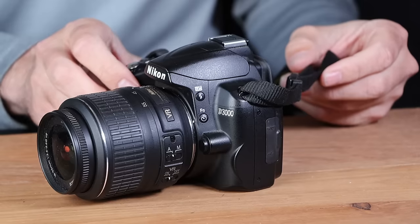The shutter count of this camera is 5,391, which sounds like a lot, but the average D3000 I sell is in the 20,000 to 30,000 range. I believe it's rated around 75,000 to 100,000 shutter actuations, so there should be quite a bit of life left. The value for this with the LCD scratch is going to be in the $125 range. I noticed we've got a couple other Nikon lenses that presumably the original owner also used, so I'll pull those out and test with this body.